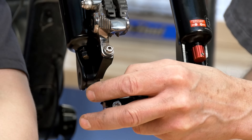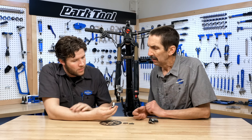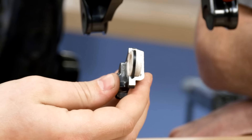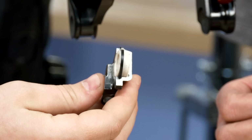We've taken a brake and sliced it to see the fun inside. The white piece here is a piston, traveling inside. It's not an o-ring — it's a square ring. That's an important thing. It's sitting down inside what is called the gland, and this channel here is going to allow some motion of our seal.